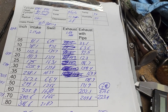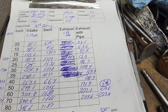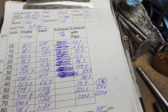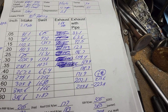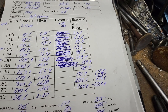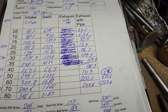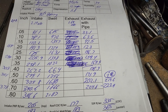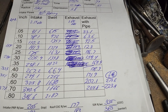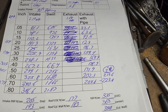I had to put in my four adapters that Brian made me up. The only head gasket I could find was a 502 head gasket, so I had to figure out where to put my bolt holes and set that up. I didn't end up using the 502 head gasket — I put some duct tape on my spacer plate to seal it, and it sealed up just fine. So this is what we've got for our 90s-ported rectangular port heads.